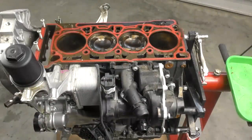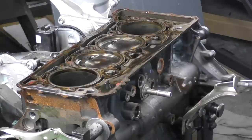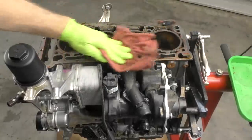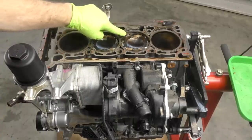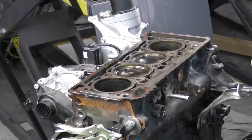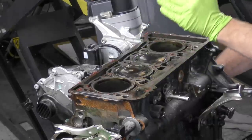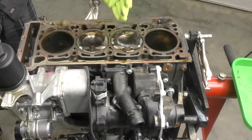One of the biggest questions you guys asked is: do we have a bent connecting rod? It doesn't really look like there's any valve-to-piston impact, but I think it is worth doing some measurement to find out. First we need to get everything out of the way and clean off the block surface. What I'm looking at here is the very tops of the cylinders to see if there are any nicks or gouges. Usually when you have that it really stands out. If the connecting rod has been bent badly enough, we'll see it here.